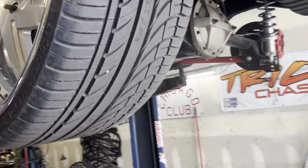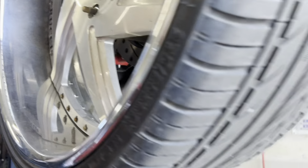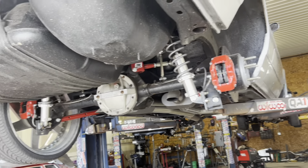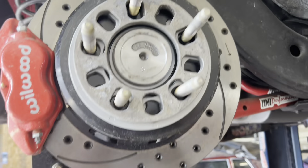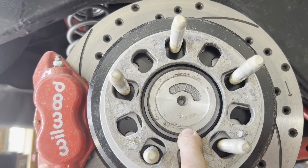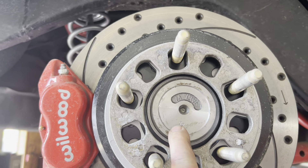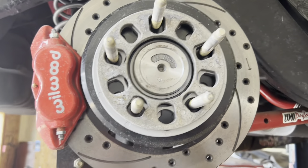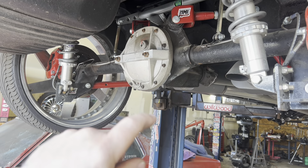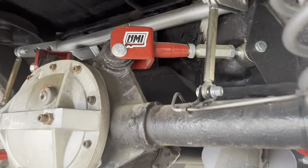There's the same amount of spacing on both sides. It's supposed to have aftermarket axles — and yeah, it does. No Mojo axles in it, there's normally a full date on there but it says 'old five.' It does have aftermarket axles, it's a 7.5 bumped up to 28-spline, and a 28-spline carrier. Hopefully there's a Tru-Trac in there — I'll have to ask.